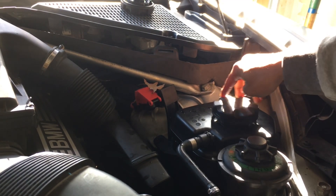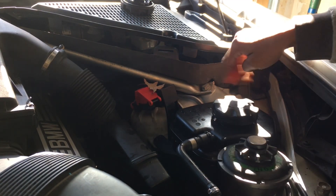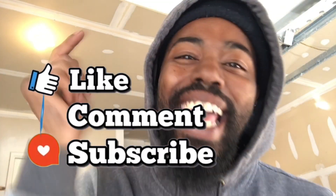Now I've got the car running, letting it warm up. I'm just going to slowly open it up and try to let some of that air that may have built up in there ease its way out. Put it back on — that's going to let all the air out. There you have it — that is the way to remove and install the expansion tank on the E70 BMW. This is pretty similar to most BMWs; the process is basically the same across models. Make sure you like, comment, and subscribe, and hit that notification bell. See y'all in the next one — peace!